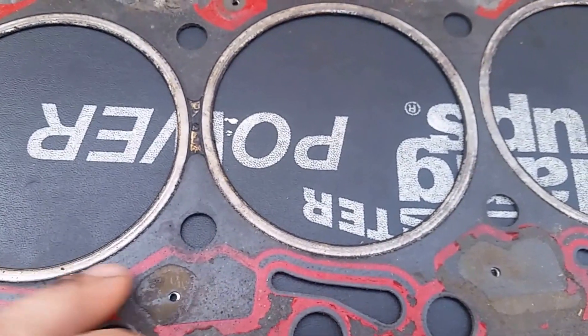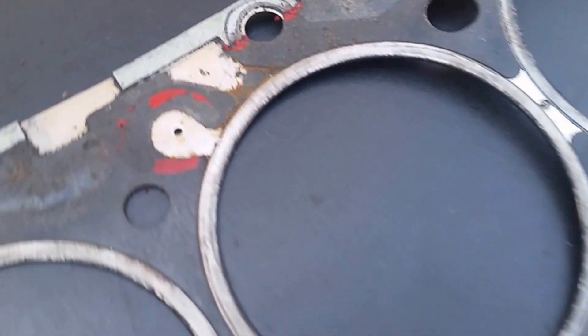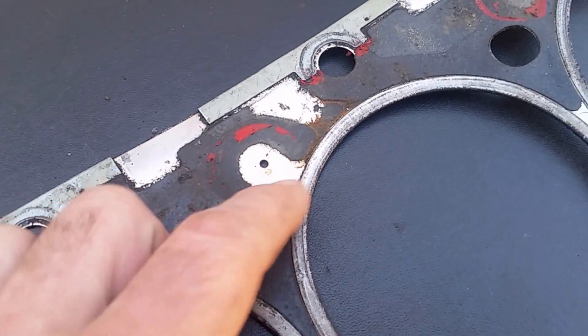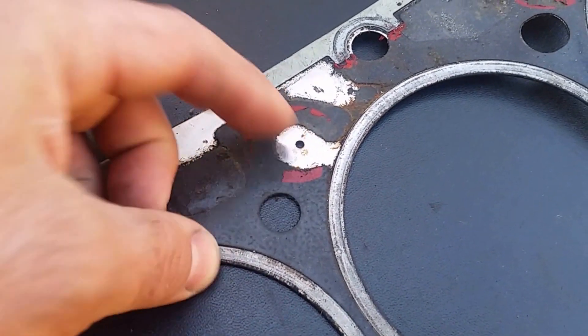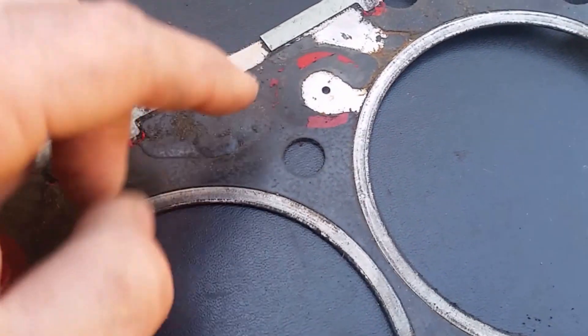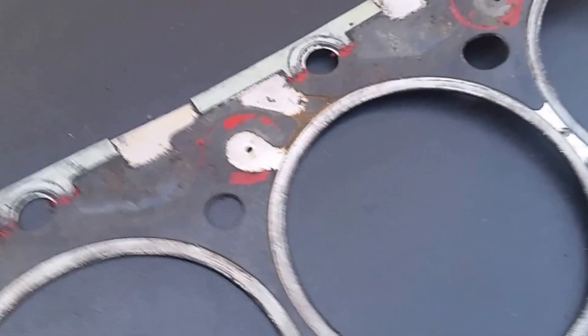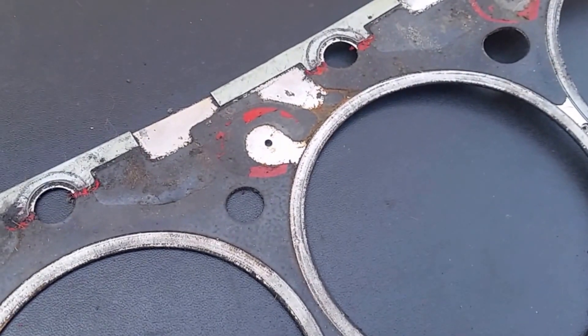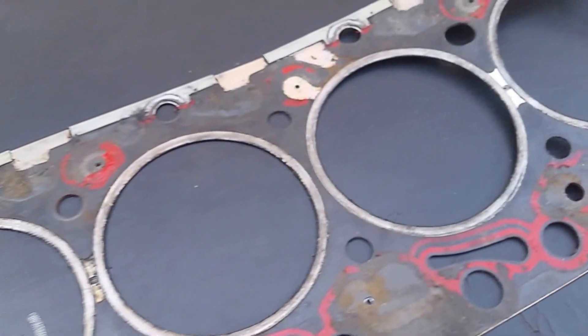Definitely a bummer, because all of these fire rings were in good shape - they were holding about 65 PSI with no issues. It doesn't look like the head was lifting at all. Everything looked great, and it was just that one little coolant leak right there. Obviously it's been going on for quite a while. The only thing I can come up with is maybe an issue with the actual head gasket itself, where it wasn't adhered well or something, and it allowed the water to get underneath the gasket and then eroded out. That's still a long shot, but it's the best I've got. If you've got suggestions, put them in the comments below - maybe it'll help somebody else going through this. Anyway, that's the last little bit of the teardown and analysis. Now she is going back together.